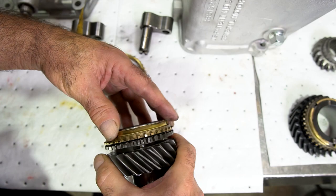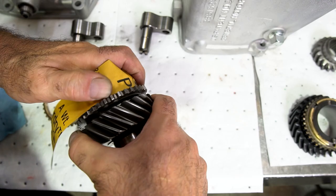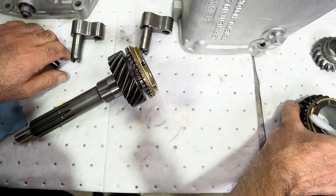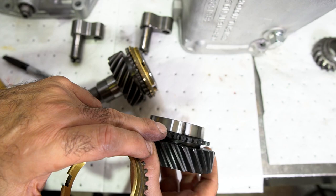Once you've got your rings sorted out on your gears, do each gear one at a time, put the ring on that fits, and it will stay on it. You can mark it with a Sharpie or measure it — this one is for fourth gear, this one for third, and so forth. That way you know where they are. If you look at this gear itself you can see you've got a nice pattern on it as well.